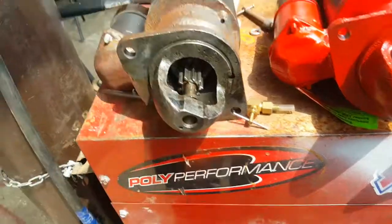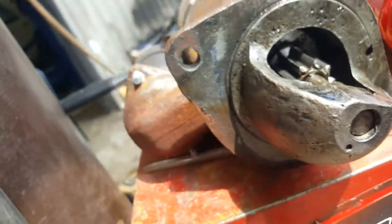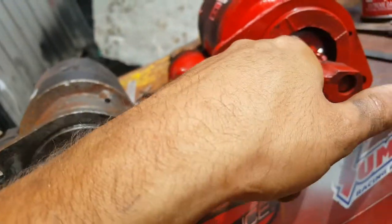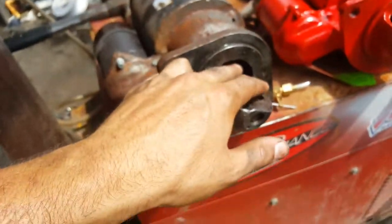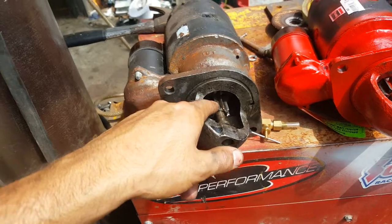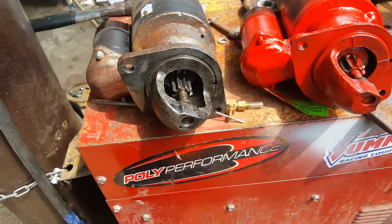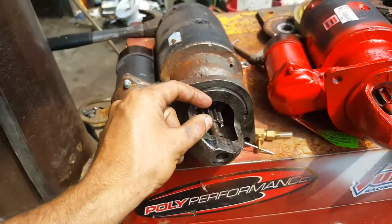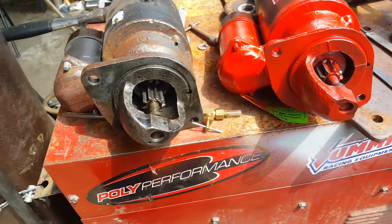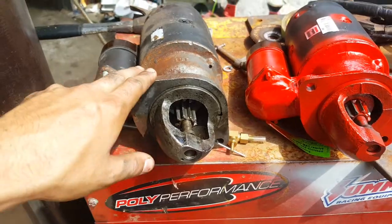Now this one, because it's so much longer, there's really no way that the flywheel will hit the round part there. So basically this here should be a better setup than this here. This gear here will actually go all the way and hit the bell housing here. Same as this one, but this one will have more clearance in the back. Again, it shouldn't matter, but only a test will tell with 100% certainty.